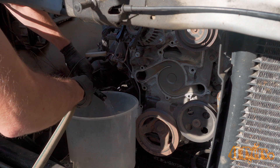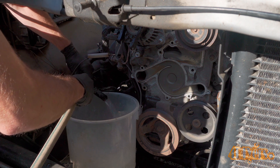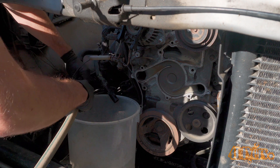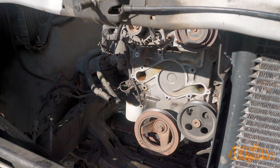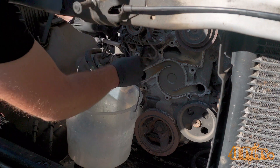If you are required to do this while the engine is still together, then I would recommend purchasing the appropriate size clear lines to connect directly to the firewall. You'll see the connection point at the firewall in a moment. As you can see I am alternating between the inlet and outlet hoses to ensure everything is flushed out from the heater core.